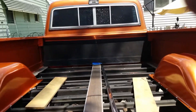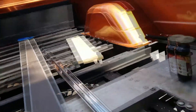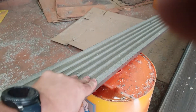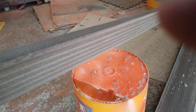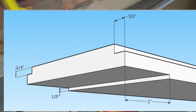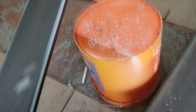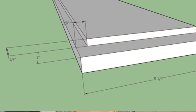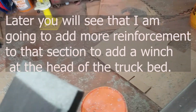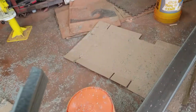Same at the other end. The board was originally listed as three-quarters inch, so I had to put it in a planer and mill it down to true three-quarters. Then I had to cut the lip on one end so it'll sit on the back of the bed under the tailgate. On the other end, so it would go underneath the lip behind the cab, I took a quarter inch off. You probably won't need to do that because you likely don't have that big reinforcement bracket in the back of the bed, so that might be an option you don't have to do.